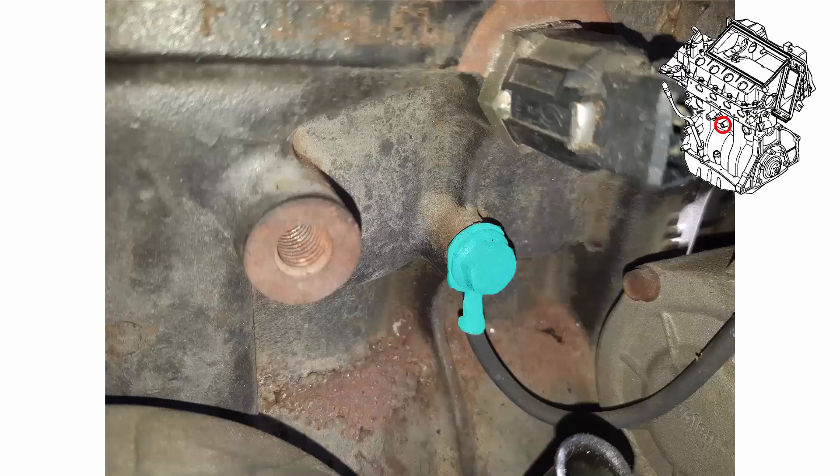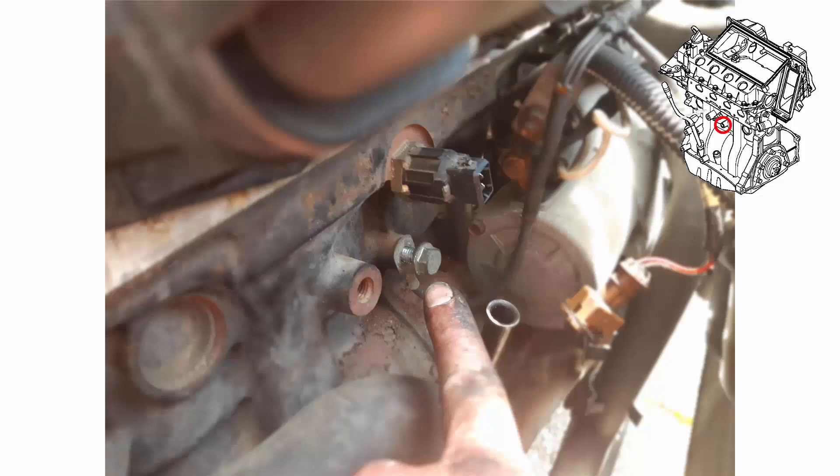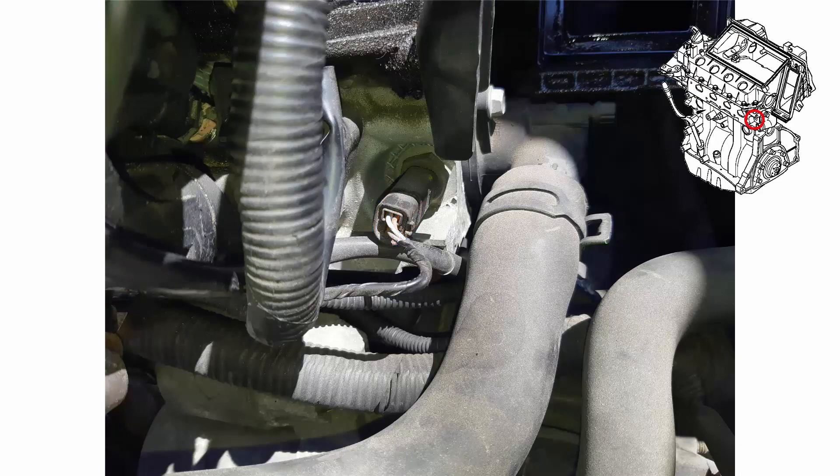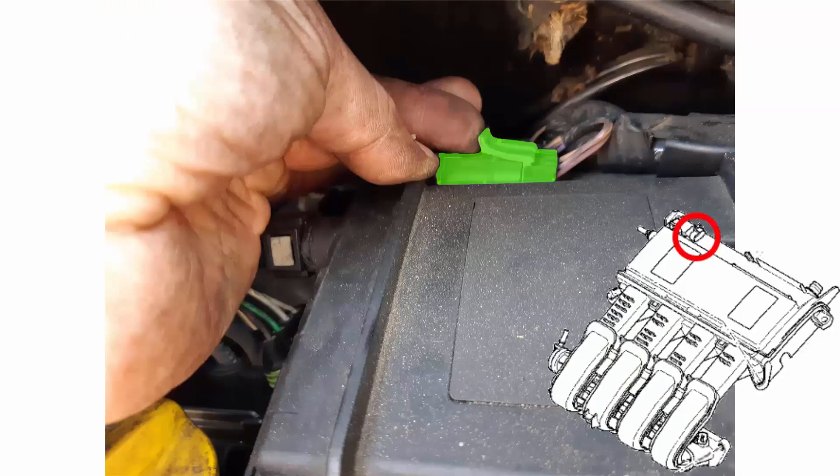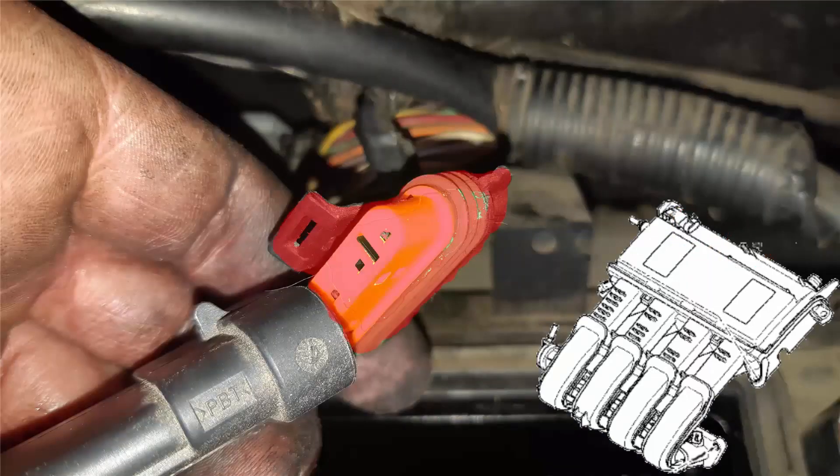After that we have a ground — with a socket or key of 13 millimeters, remove the bolt and then place the bolt back so as not to lose it. Let's remove the coolant temperature connector. For the MAP sensor, lift the tab and then pull out the connector. Let's do the very same thing for the injector interface — this is the connector between the injectors and ECU.